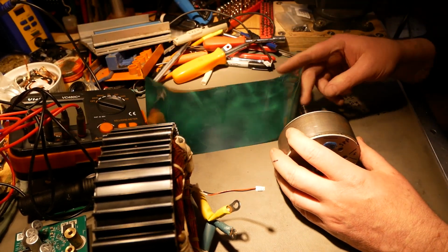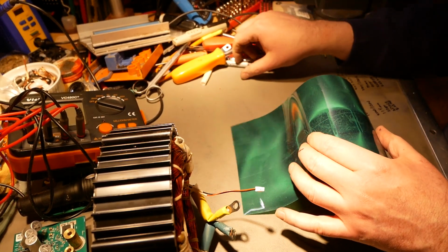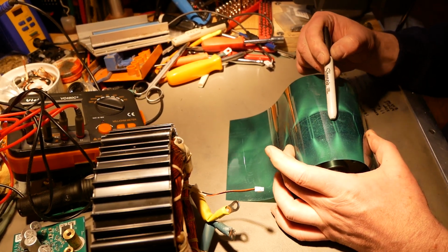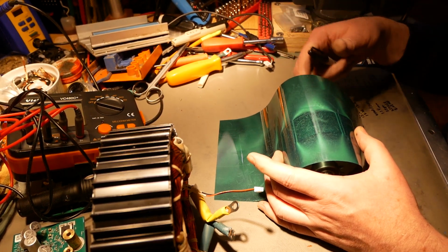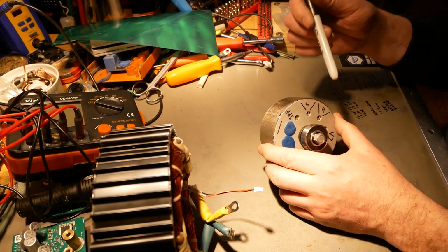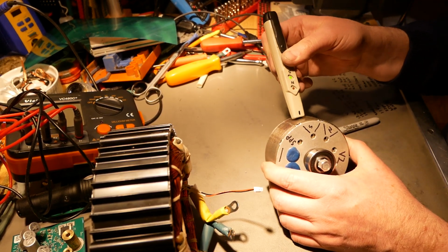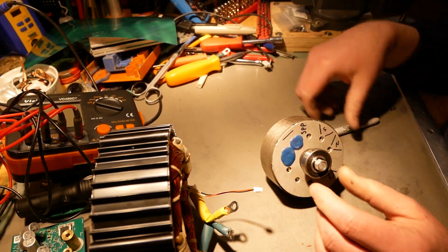So here is my magnet paper, and like the V1, you get the same pattern on here. Right here is a zone of a magnet, then you have the junction between two V's right there, and here's the zone of a magnet, same thing. You've seen this already, and I've marked off two of them here, south and north. And here is my little pole detector, and south, north, they're alternating like they should.